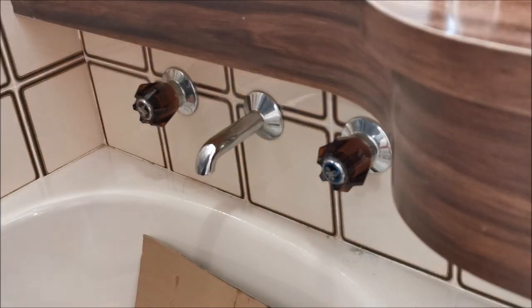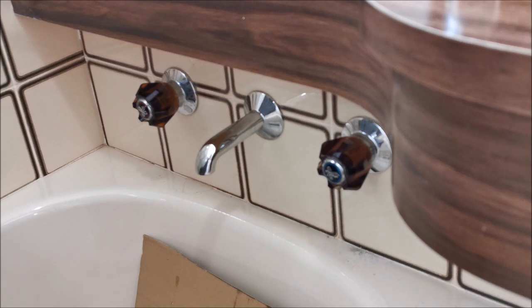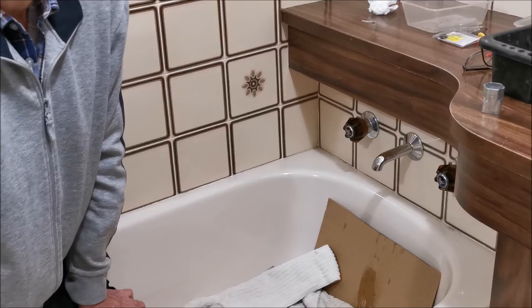Once that's done you can tighten the taps a bit more, but don't over-tighten them. Especially with a new washer, just tighten enough to stop the dripping. The washer will last longer - if you tighten very tight you compress the washer and they don't last as long. That's the job done. If you found this useful please like and share this video, subscribe to the channel, and if you have any comments or questions scroll down to the comment section - we'd love to hear from you. Thanks for watching.